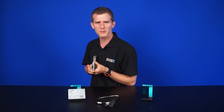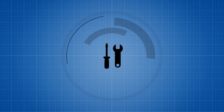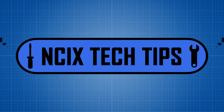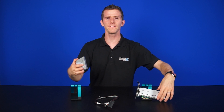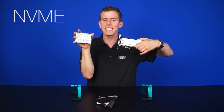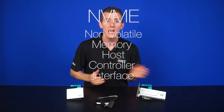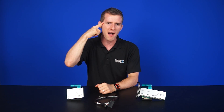Say hello to my little friend. These are the Intel 750 series SSDs — the first available with NVMe, the full name for which is Non-Volatile Memory Host Controller Interface. You can think of it like a newer version of AHCI that is specifically designed with the lightning-fast speeds of SSDs and the high bandwidth of PCI Express lanes in mind.